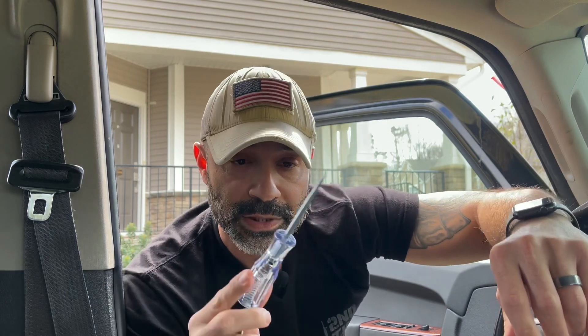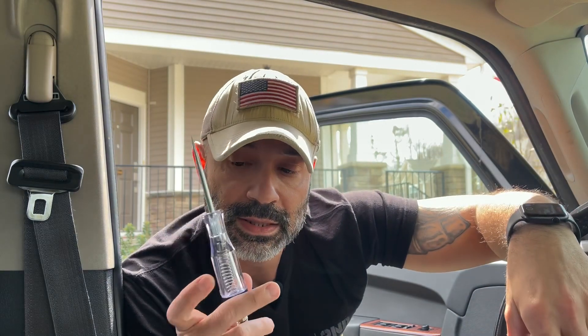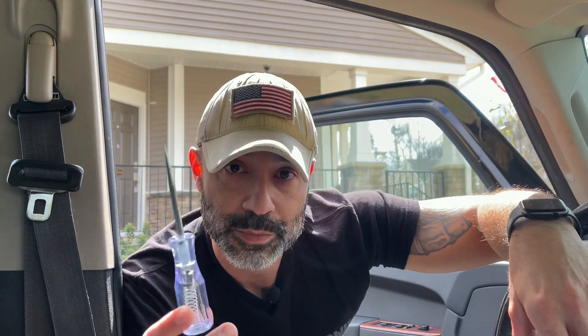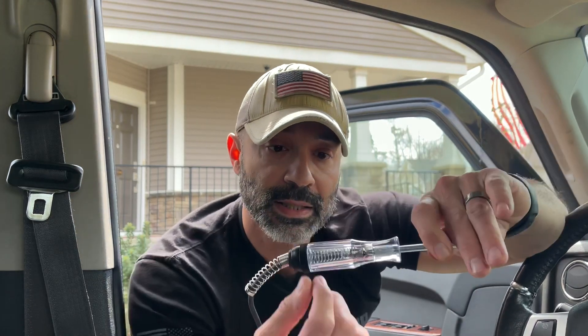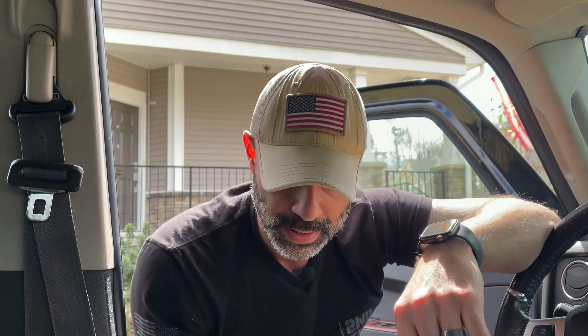For that I got a circuit tester — the other side is grounded — and I'm going to start sticking this into slots. If the Jeep is turned off and the light comes on when I shove it into one of the fuse box slots, that means it has constant current. But if I stick it in when the Jeep's off and the light doesn't come on, that means either it's not constant or it's a messed-up fuse. So if I turn it on and it doesn't come on, that's a good sign. Then I turn the engine on and try that same slot again — that time I should see light, which means it's not constant, and that's where I'd put the red wire.